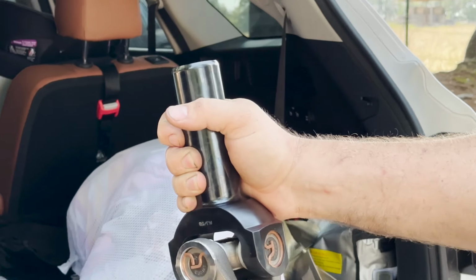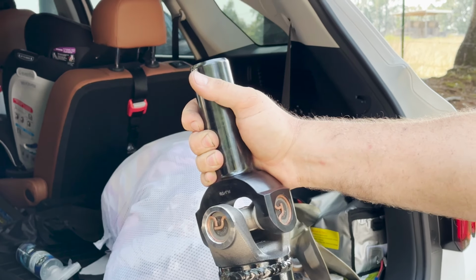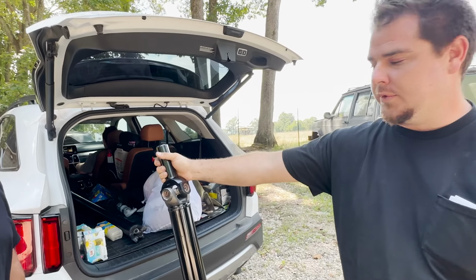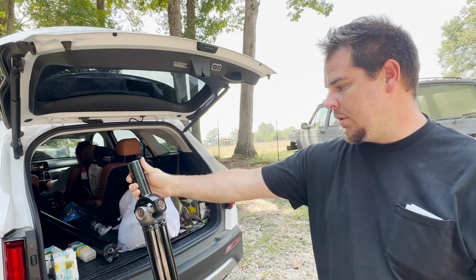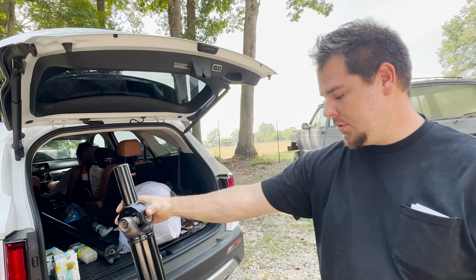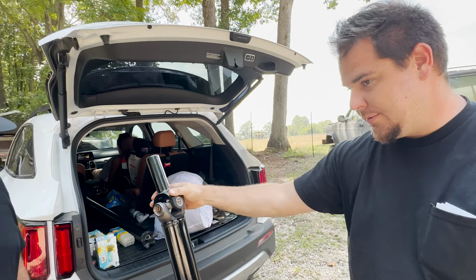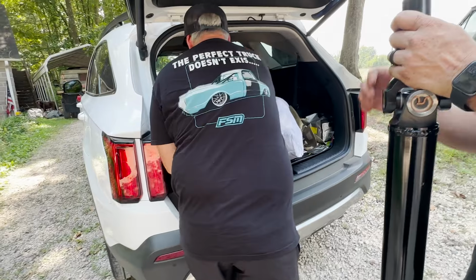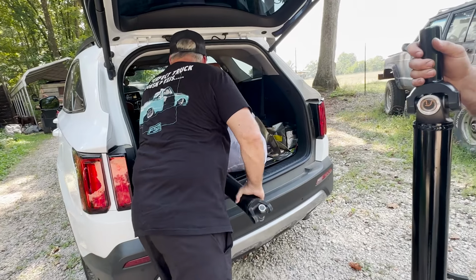So we went 3-inch on it, give you a little bit more clearance, less rotating mass. Thank you. So it's .083 wall DOM stuff now. Okay, don't worry about it. Nice. Chromoly yoke. Yes. Let's see if she fits. All right, let's go back up. There's your other one there. Let's compare and contrast. Yeah, we'll let it hang around.